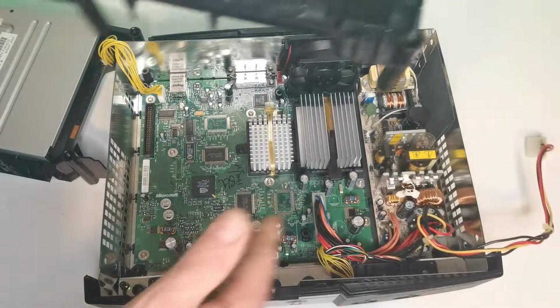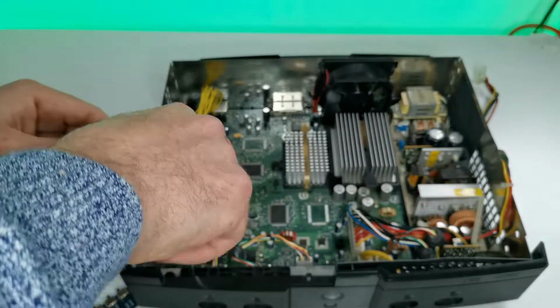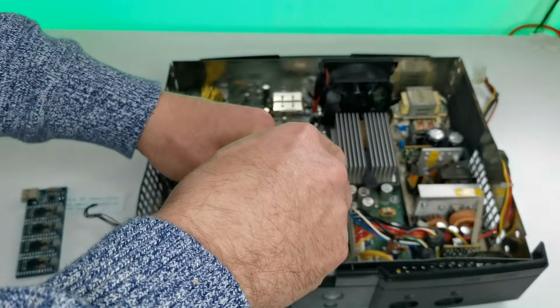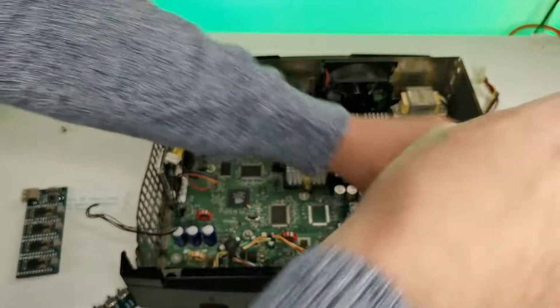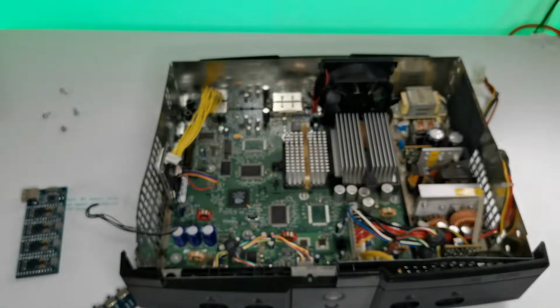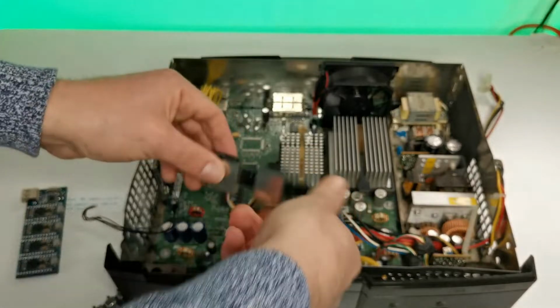There are a couple of screws closest side to you from the main board next to the controller ports. They need removing with a T15 screwdriver. If needed, a purchase link will be below as well in case you need them. And then you simply remove the connection from the main board, just a little yank. Don't get too tough, as they were worth keeping as well, just in case, you know.